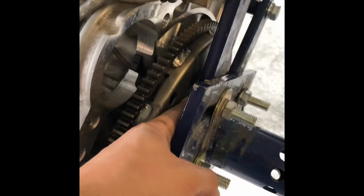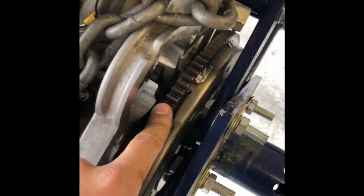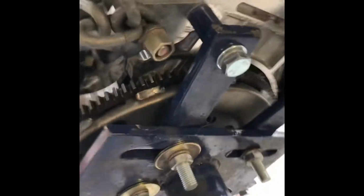One thing you wanna look out for when you're tightening these up, you gotta watch these bolts. You don't wanna put any pressure on your pressure plate. No pun intended. Yeah, but anyway, you don't wanna torque this inward, because then you're gonna create bigger problems than what I already have, or what you may already have. I don't know if the engine will spin like this, to be quite frank with you. It may. It's gonna be very close, because some of these bolts are really close to my flex plate bolts. Again, this is just so that I can put it on a stand for now.